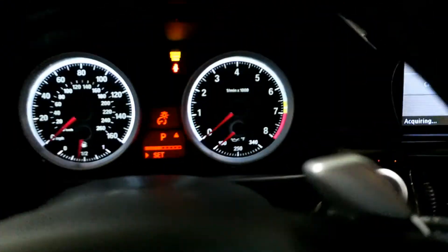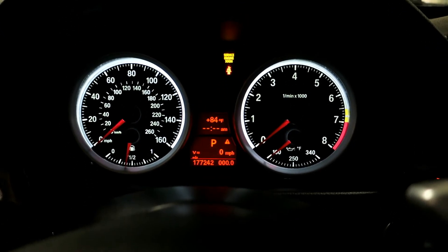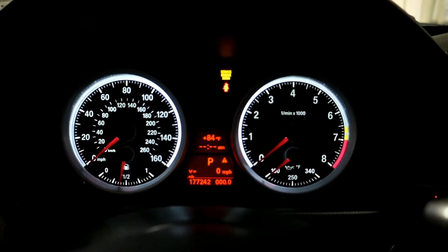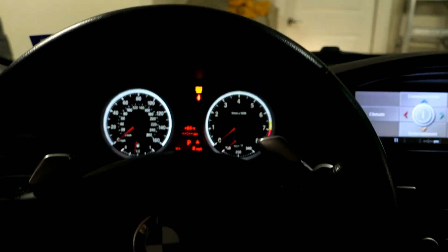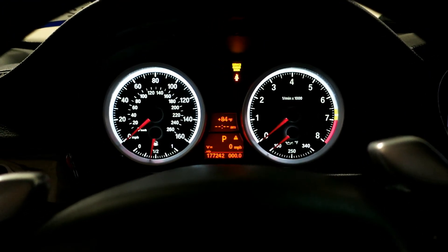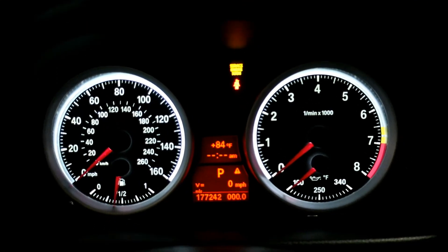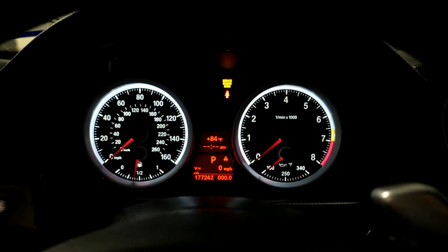With headlights on I can set my brightness using the BC button to bump it up. That reset because I actually reset the whole COMBI module, the gauge cluster module. So now when we turn the headlights to the off position they stay on and they're fully bright. I do have to reset my clock as a side effect of doing this. Definitely one of the easier things to code, and you don't necessarily have to convert your gauge cluster to white to benefit from this — even with the original orange gauges it just makes things a little bit easier to see during the day. Thanks for watching and good luck.